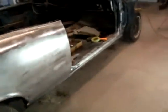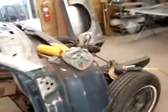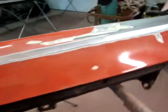Alright, back on the 66 GTO today. We've had some parts swapping around this car because of parts that were in worse condition and some of the other parts the owner had, but this is what people never seem to realize. You look at this fender, you can see it was red painted, there's some orange peel in it and everything. Looks like a one-stage paint, either urethane or enamel. But here's what always happens. You don't know what was underneath. This nice multi-color, multi-layer unit has 13 layers. My battery's almost down. I'm going to bring it back and we'll count them.